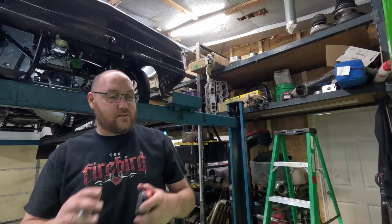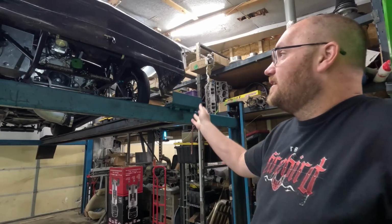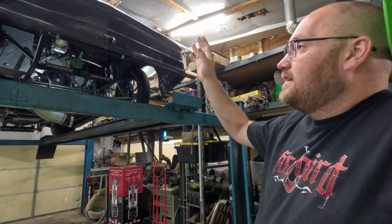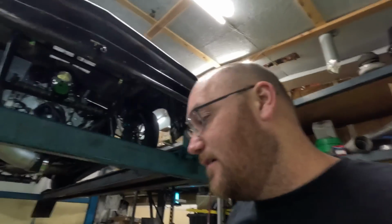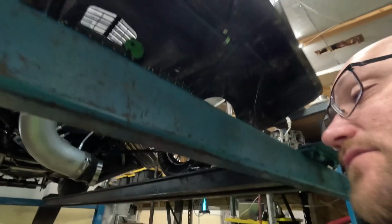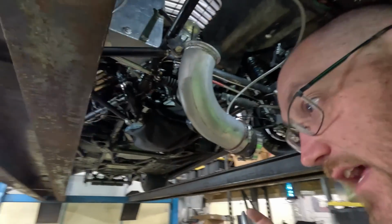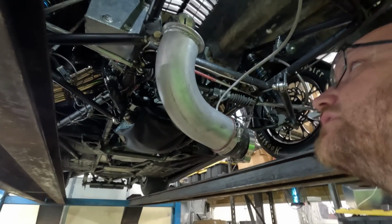So it's just a big 3/4 inch thick plate that goes across. And if we just had it extended to go across the balancer face and then tie into either the add-on bolts for motor plate or timing chain cover, we could have a crankshaft bearing support system in here. And that would help with this pretty short depth of balancer hub engagement that these motors have, and give us some support.